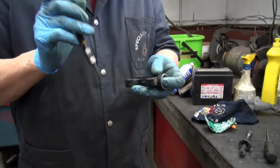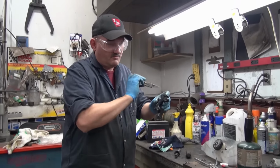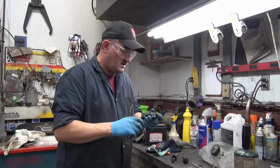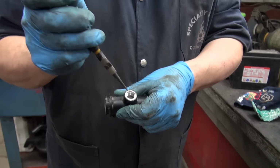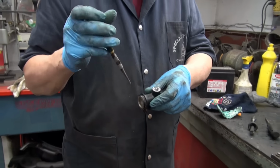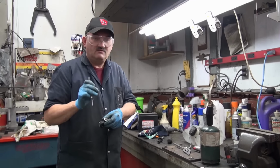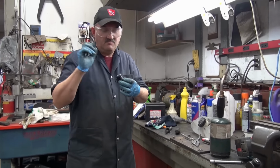Usually what you do when you got these seized, you get as much oil out of them as you can, you put them in your workbench, and you heat them up a little bit with a propane torch, and then you put a rag over this end, and you apply probably 3 or 4 pounds of air pressure, and it will blow the plunger out normally. Okay? And then you check these little ports in here, and there's two little ports. There's one little tiny, tiny one here. That's a bleed off, and what happens is when you put your foot on the brake and you take your foot off, it allows a little bit of pressure to come back out, so your brake will free up. If you have a motorcycle with the back brakes seizing, remember we had a CBX cylinder here a few years ago? He had looked everywhere, he couldn't figure out why the brakes were sticking. It was that little port. So I used a propane orifice file, and I went in and I just filed it a little tiny bit, and it fixed the problem. So something to keep your eyes out for, folks.